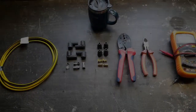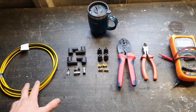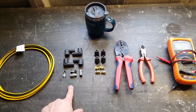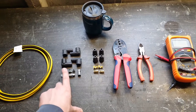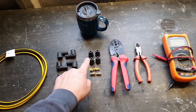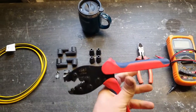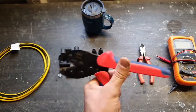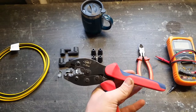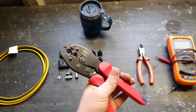These are the tools you're going to need to do the job. I've gone with 7mm HT wire, copper core, cut to two metres long. I've got 90-degree fittings for the spark plugs and boots, and straight boots for the distributor. I've got this tool for stripping the wire and making the ends up. These are not too expensive — you can get them for about £30 if you're English.